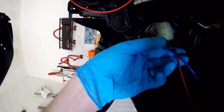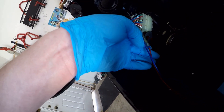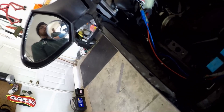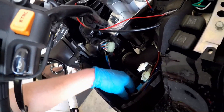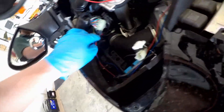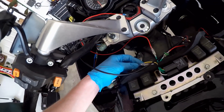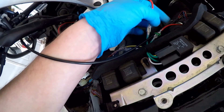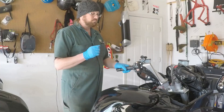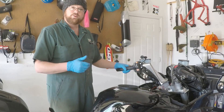So underneath this accessory, these two wires right here are a power and a ground wire for an accessory circuit. This power only comes on when the bike is turned on. So I have used those to run the switch on my relay — these two wires here come into the relay. When this circuit energizes, it activates the relay and completes the circuit between those two wires when the smaller circuit engages. Then these two wires here — one of them goes directly to the positive terminal on your battery, and the other one I'll show you where that goes in a minute.